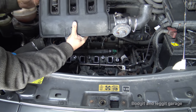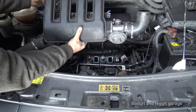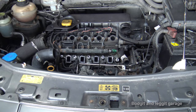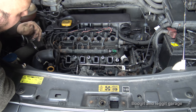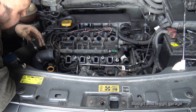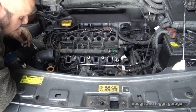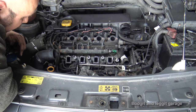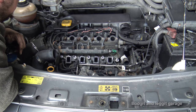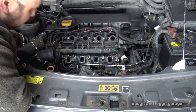There it is — the bolt is inside there. Put all this together to make sure it's in one place. The intake actually looks quite good once it's off — there's a bit of build-up but not a lot. There is a little bit of wet in there, which could possibly be the turbo starting to go, so it's worth checking. No harm cleaning the intake while you're there.